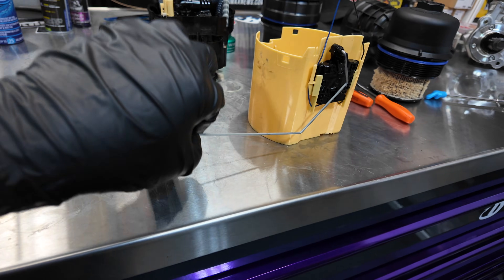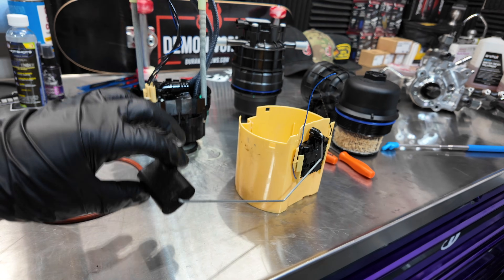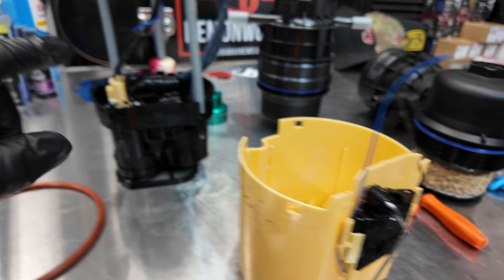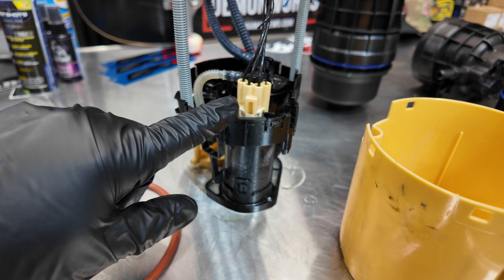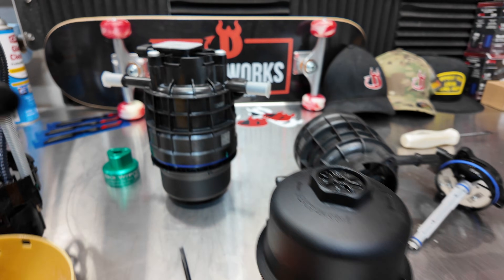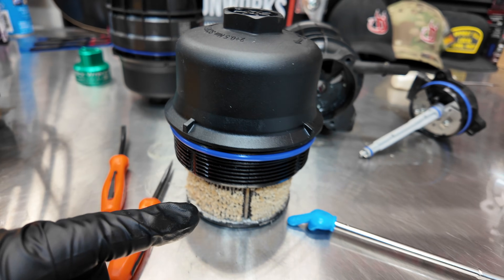This is our float right here — as you fill up the tank it floats up showing a full tank, floats down showing an empty tank. The real key item is this pump. This three-phase brushless pump is a very good pump, and when it starts to go out there will be debris found inside the filter housing. This is probably how you'll recognize the filter housing — it's on the rail and this is where you unscrew it.